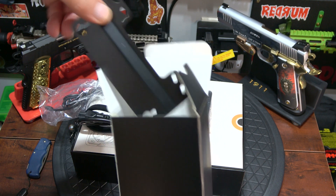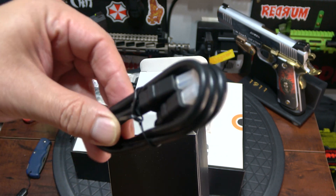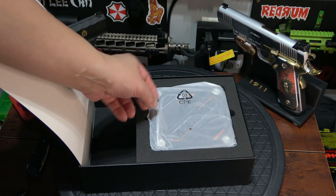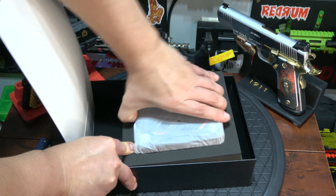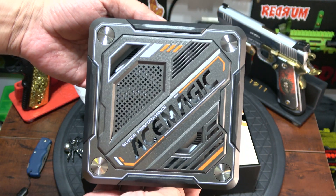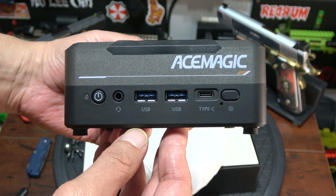I've been reading through forums and watching YouTube videos, and the easiest solution is to wipe the drive and reload Windows 10 from an older unused machine onto the AM18. You can flash a USB drive directly from Microsoft's website. After the clean reinstall is complete, use the old Windows 10 key to authenticate, and soon Microsoft will send new updates stating your machine is Windows 11 ready and can complete the upgrade from there for free. Voila!